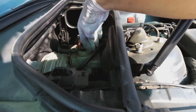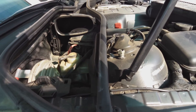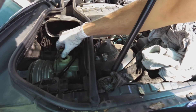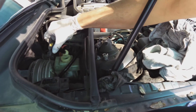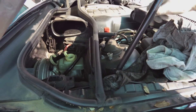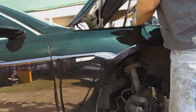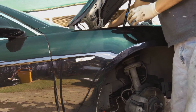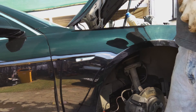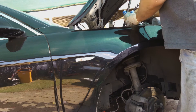Before you open the reservoir, clean it - there's a whole bunch of dust here and you don't want those dust particles to fall into your brake fluid. Now that I've wiped off all the excess sand and dust, I'm going to open it, let it lie on its side, and top it up with brake fluid. I'm going to overfill it. Open the other one, puncture it, have it nearby.